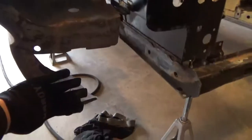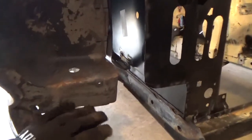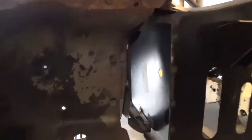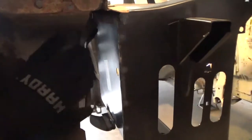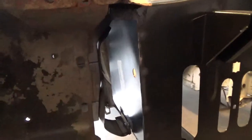I'll probably fit the valence and get a stone deflector to put up here as well, so I can get these parts to fit together and make sure this fender is where it's supposed to be before I cut the spot welds and move the bracket up to meet it. I don't want to just toss some spacers in there.